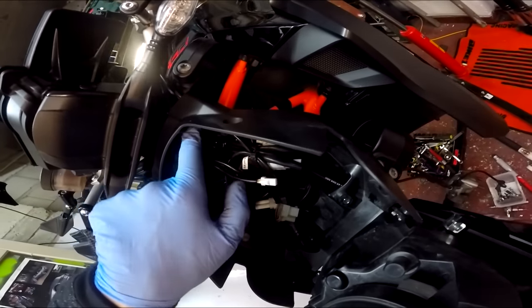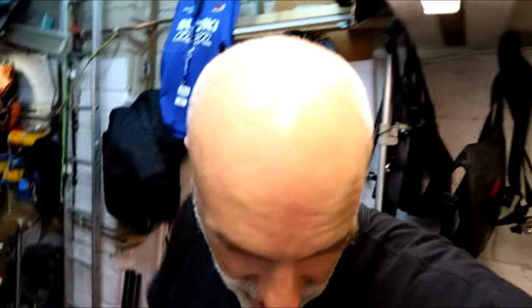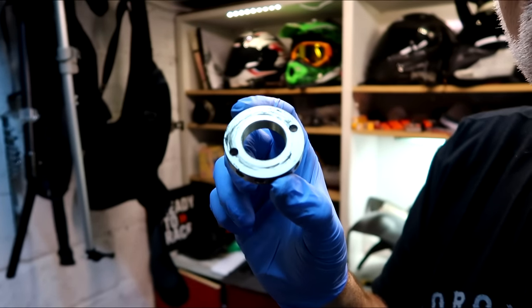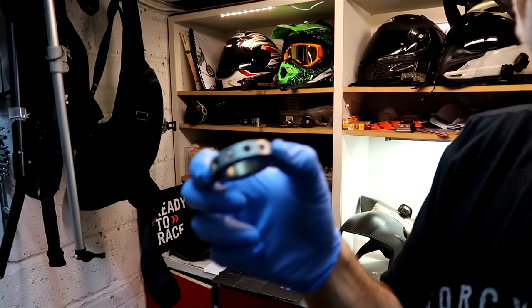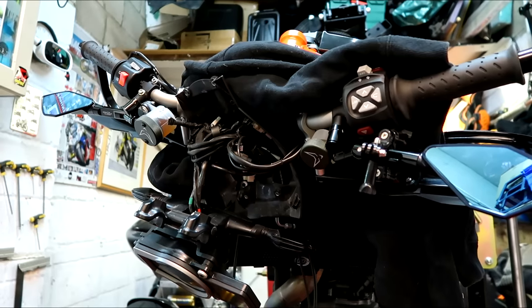Why is it not as simple as it looks to take this headlight off? What a mess. You know I complained about some handling issues and it feeling very different to the new one? Well this - which is the lock nut that holds the whole yokes together, presses the top and bottom and holds all the bearings together tightly - that was literally hand tight. Literally hand tight. So that's really not going to have helped the handling issues. I think the whole front end may have been a bit loose.